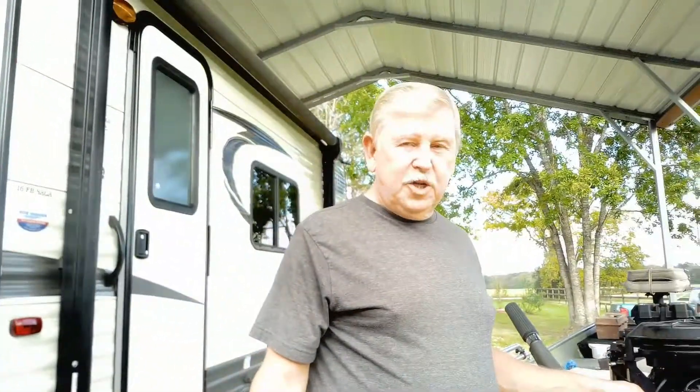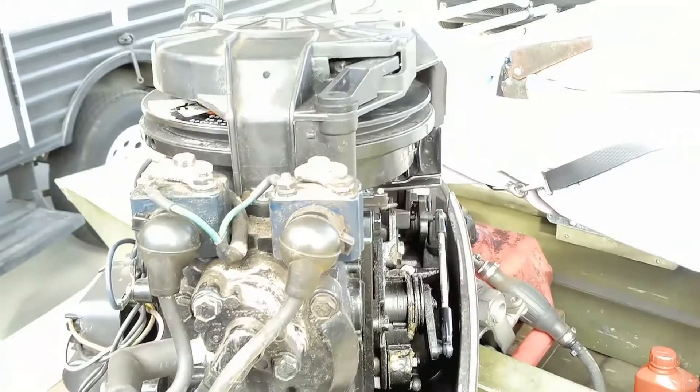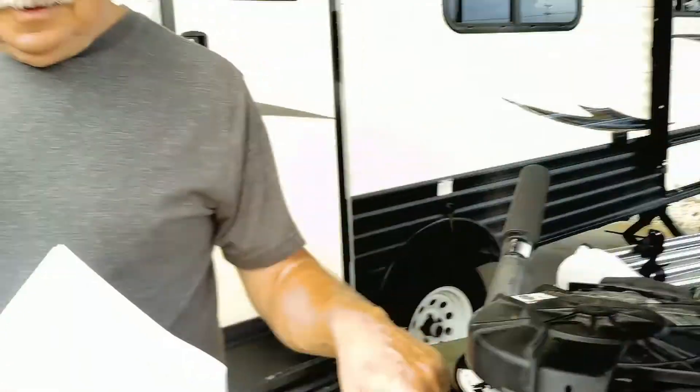So I jumped to the coils and checked them out — the coils were good. So it was one of two things: the trigger underneath here in this head or this one. So I ohmed the trigger out and it was bad.